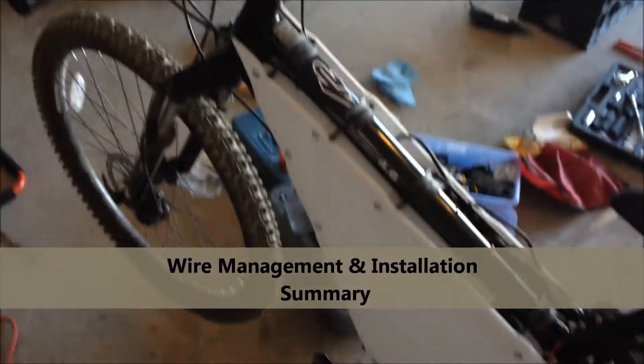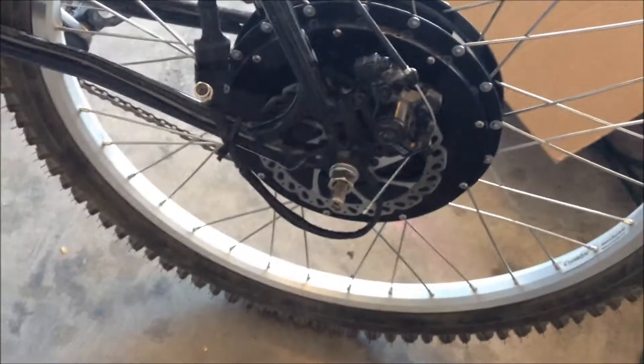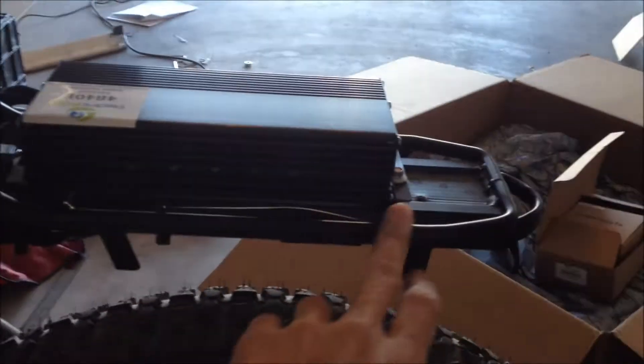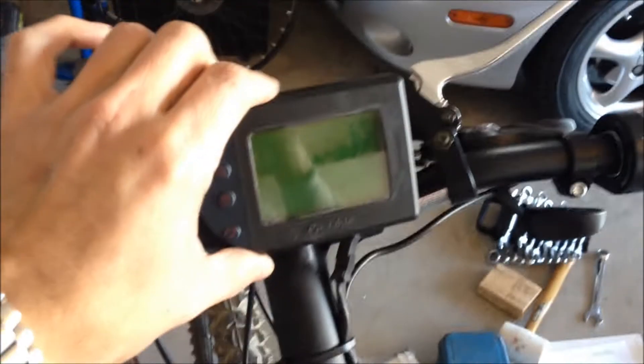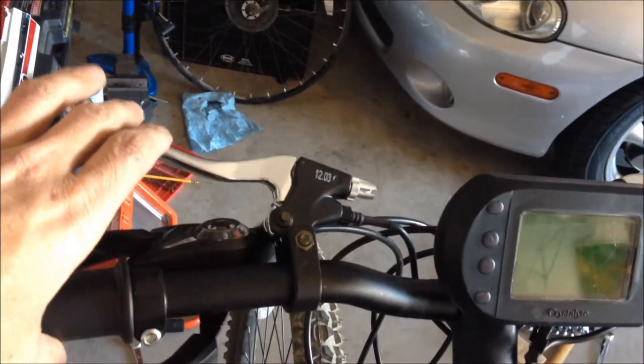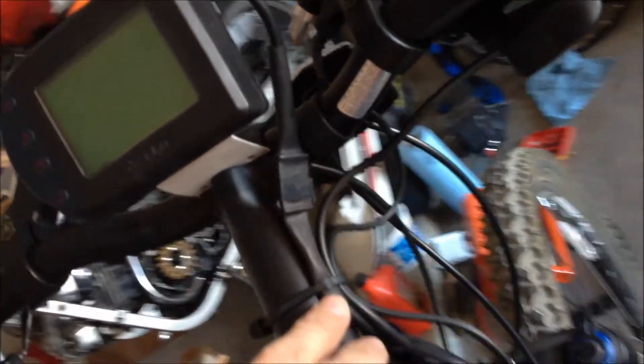I finished mounting everything short of the battery in the Phoenix 2 cruiser kit. I mounted the wheel and motor into the bicycle, the double kickstand, the motor controller on the rear rack, the half twist throttle, the APM display, and the brake inhibits — basically an emergency cut-off switch for the motor — and ran all the wire. Some notes on wire management: all the wires from the front controls I cable tied to the stem, and for the motor wire I wrapped the loop around the rack to take up the length.